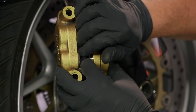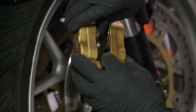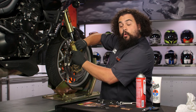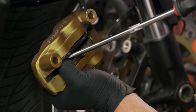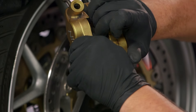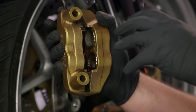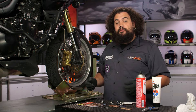So I'm going to use my fingers to push these in — usually I'm strong enough to get them in there. You'll notice as you drive some in, some other ones might pop out. But eventually you should be able to work these all back into their bores. Now if it turns out you're having trouble doing that, one of the things I like to do is grab the old pads, put them back into place, and take a pry bar or a flathead screwdriver to drive them carefully back in. What we're looking for is these pistons to be more or less flush with the caliper body itself — this is going to give us the room we need to get the pads back into the caliper and the whole assembly back up onto the bike.